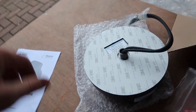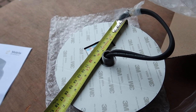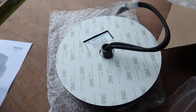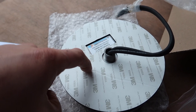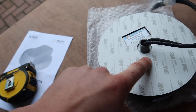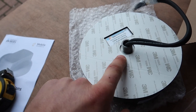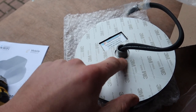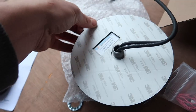So what I did first of all was measure the die, which is 170. Then I'm going to get up on the roof and measure the center of 170, which will be 85mm, and then I'm going to drill a pilot hole, and then via the instructions it tells you to use a 25mm hole saw. So I'm going to do that, cut the hole saw, and then file the edges, touch it up with some rust proof paint,